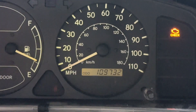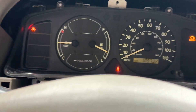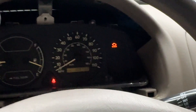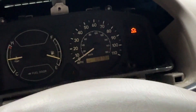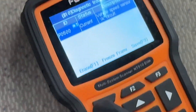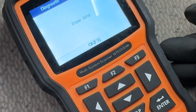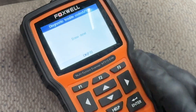Okay, there we are. Mileage is accurate, car is good and warm. This usually only happens when it's really warm, which is probably why the person in Virginia that I got it from ditched it — because it's a perfect car otherwise, only 109,000 miles on a rust-free 98 Corolla. It is P0500 — that's the code — which I am now going to erase. This is a Foxwell 510 Elite with Toyota-specific software loaded on it.